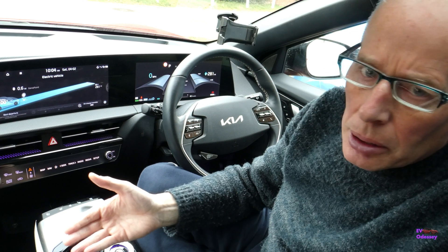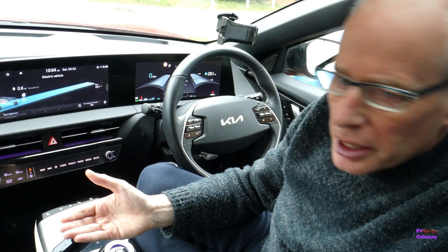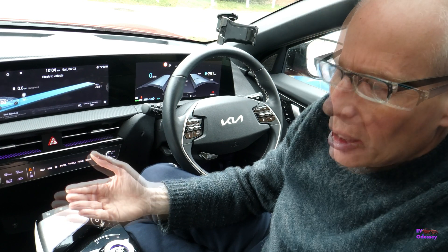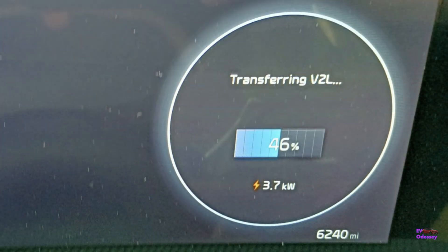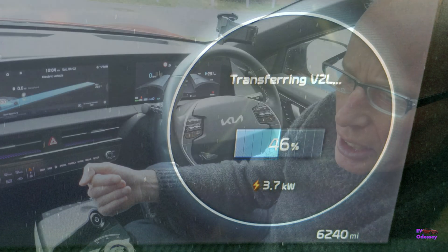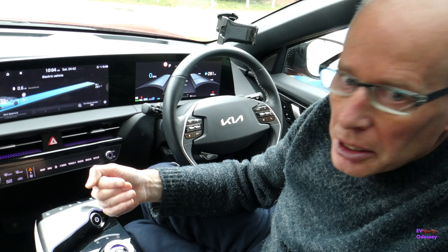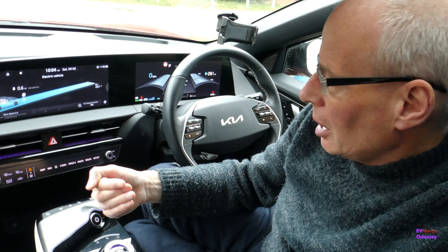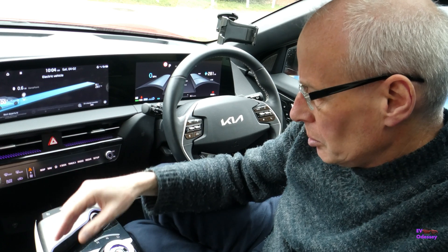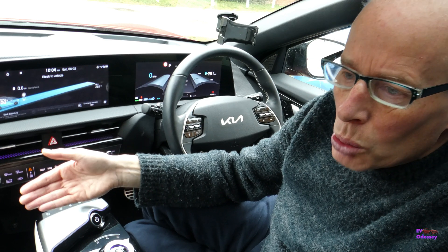So what can you plug into the vehicle to load? In the European models you've got 3.6 kilowatts to play with, and sometimes that can be stretched up to 3.7 — I've had it stable at 3.7. In the US it's half of 3.6; I think it's 1.8 kilowatts, because of the way that voltage and amps are calculated. But basically, look at the base of whatever you're going to plug in, check the wattage, and that's a good guide as to what will work.